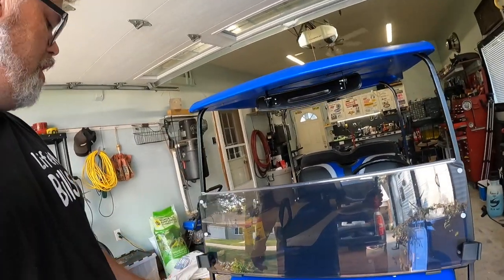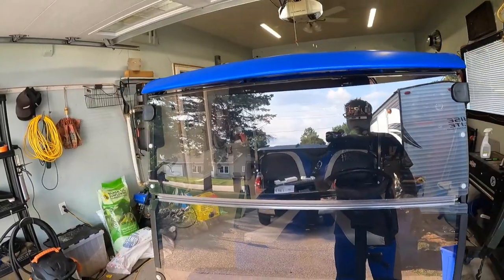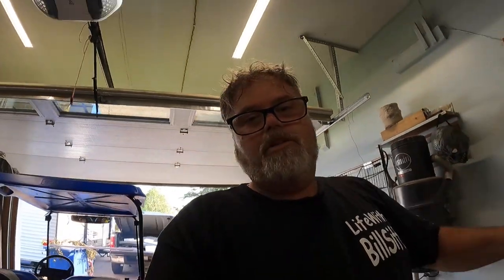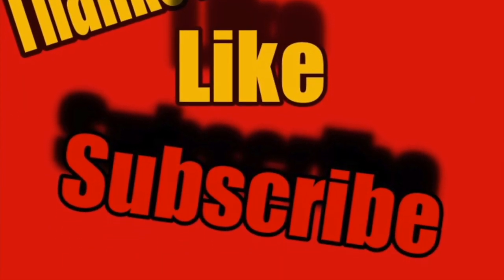Just wanted to add to the video here real quick. I drilled those holes down and dropped it down. If you have a TXT and you want to drop the roof in the front to give it the slope-down look, three inches and a stock windshield will still work. At the bottom holes, all you got to do is come down three quarters of an inch and drill a new hole. You still have clearance along the hood and it shuts with a three-inch drop and fits nice and tight. There you go. So we'll hope you enjoyed this video — don't forget to subscribe, like, and hit the notification. Welcome any new subscribers to the channel. Let me know what you think of the mods on the golf cart. We got even more into this golf cart now. Hopefully everybody's having a good day. Thanks for coming along with this. Until next time, love y'all — bye!